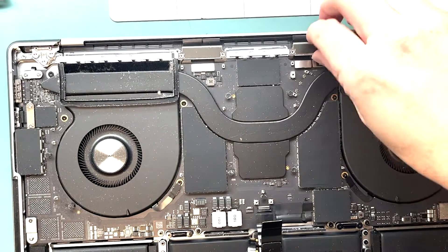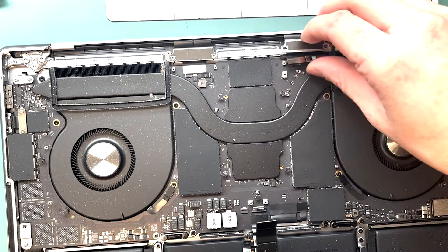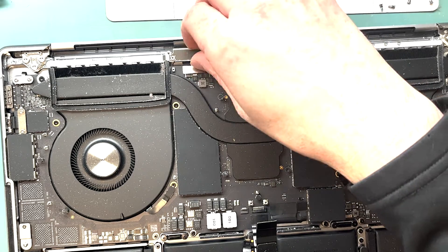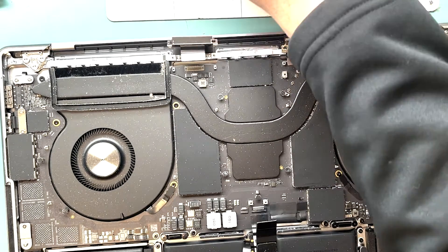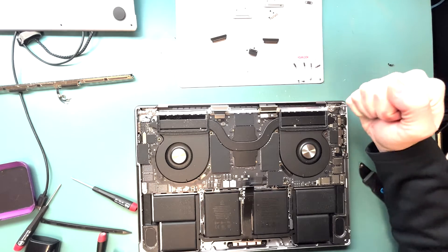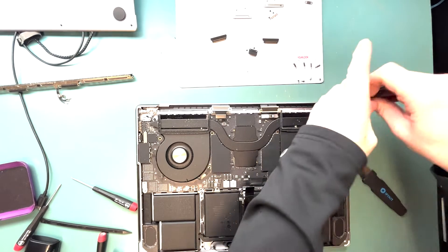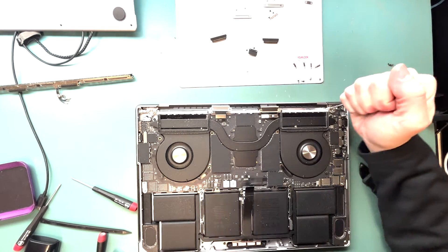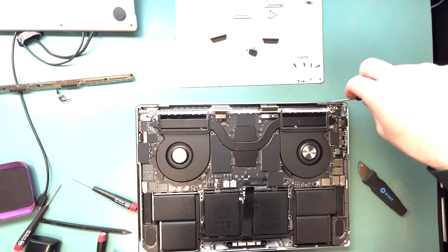For the metal brackets, grab from the top with your thumb and pull them off. There's also a little plastic piece you'll take out as well — don't lose these, they're not magnetic so you can't pick them up with a magnetic screw holder. Grab your T8 screwdriver and remove the six screws for the hinge: first unscrew the two on each side, loosen only one of them, then open up the screen and remove those final last screws — one screw per hinge — to make it easier to take the screen off.